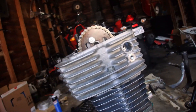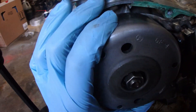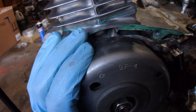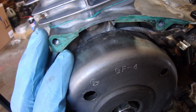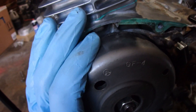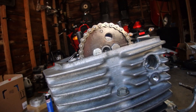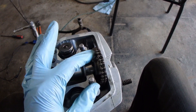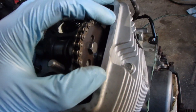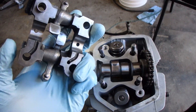As I turn the engine, you can see the sprocket go in. I'm going to find top dead center. There's an F here and that F means fire — that's when the spark plug fires, just before top dead center. When I line it up to top dead center, there's our little dot right at the top. So now that we've got the camshaft, the cam sprocket, and the engine timed, it's time to put on the rocker arms.